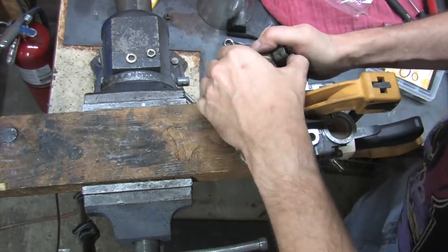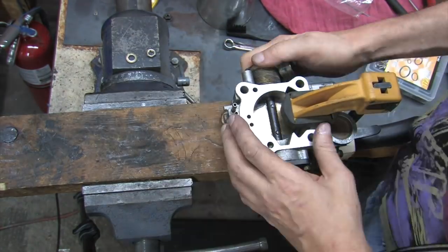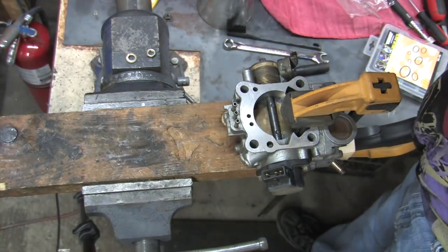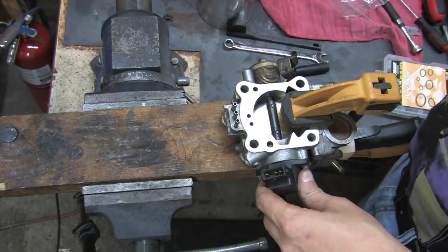Again, assemble the spring sandwich the same way as on the others and give it 1¾ to 2 turns before feeding it into the slot and honking it down. Check the spacer position and install the lock washer and the nut hand tight.